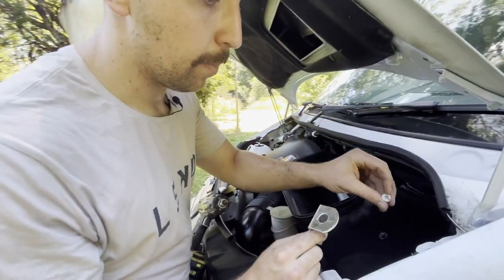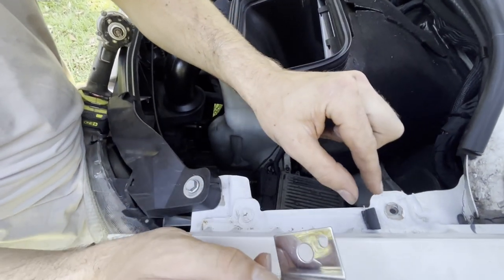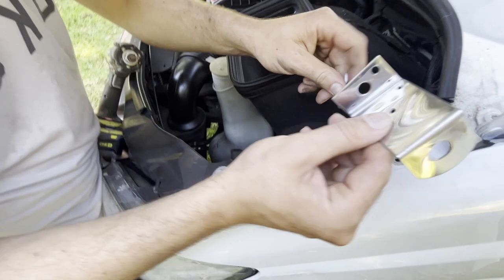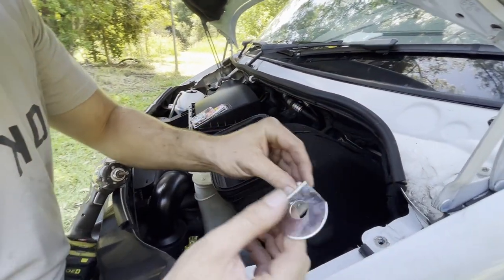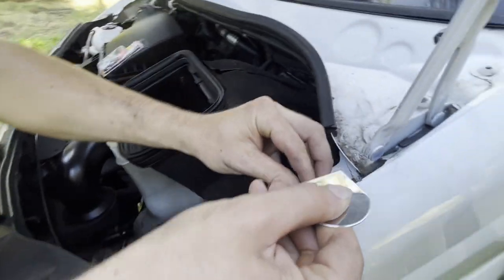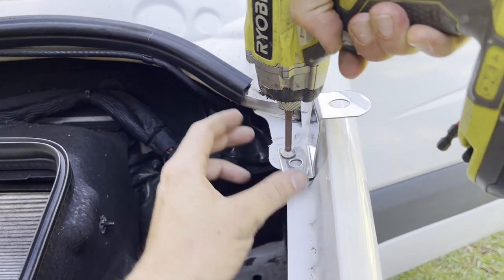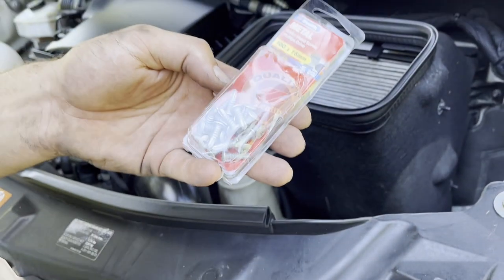We're now putting the aerial mount in. I'm going to use that guard bolt with a little bit of rubber as a spacer - a leftover piece from the diesel heater install - just to level it out. I've drilled an extra hole there and put that in, and for the rest of the mount I'm just going to put some short self-tapping metal screws in.